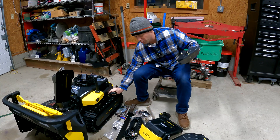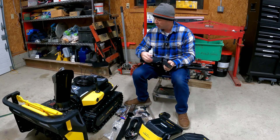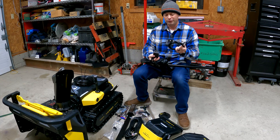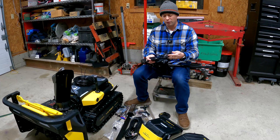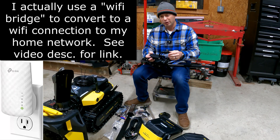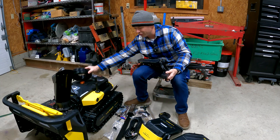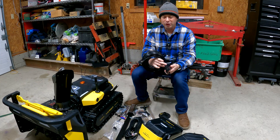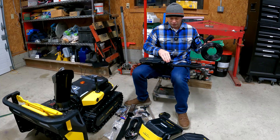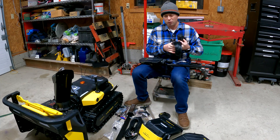In the piping is where your cable runs. This unit gets powered by Ethernet. They include a power Ethernet injector with a short power cord and a three-foot Ethernet cord. You plug this from the power-over-Ethernet injector into a router — your main router, a secondary router, or if you have Ethernet run through your house. They also provide a 30-foot Ethernet cable that goes from the POE injector through the inside of the pipe and feeds into the WAN port, which powers the unit and gives it internet — a requirement on this model.